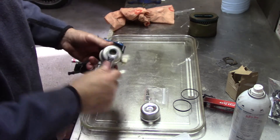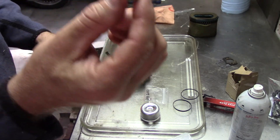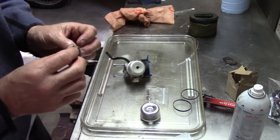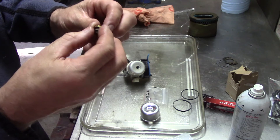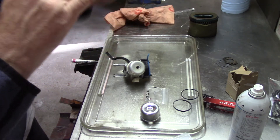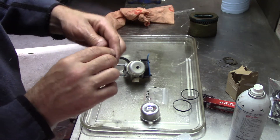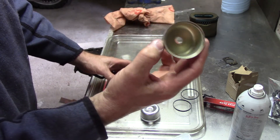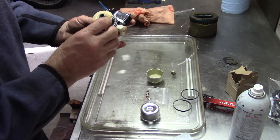This thing has little holes in it. I just take a little pipe cleaner or a little piece of wire, run it through there, and then run some air through there also in the center. You want to get that sucker clean. Sometimes there's a piece in there preventing everything from coming through. I don't see daylight coming through this way — something's probably gummed up in there. But actually, when I open it up, that's pretty clean — clean as a whistle. A little bit of rusty-looking crap on the bottom there, but that's way cleaner than I thought it was going to be.